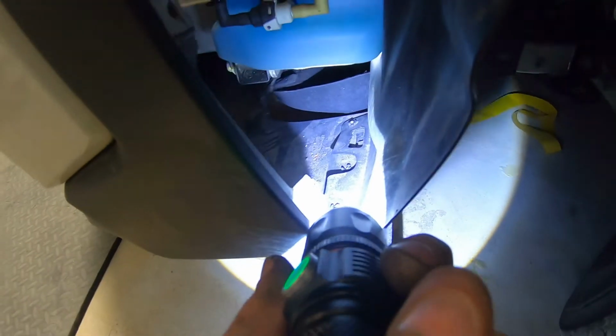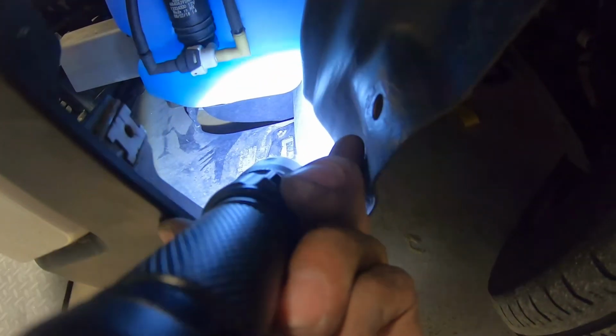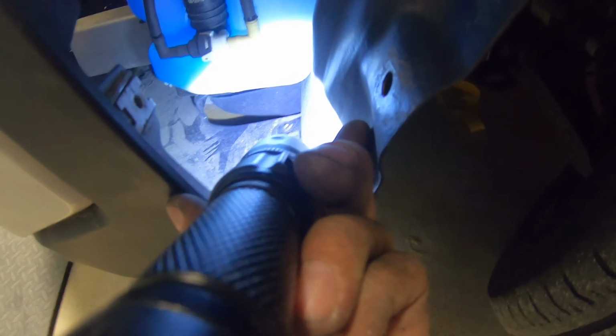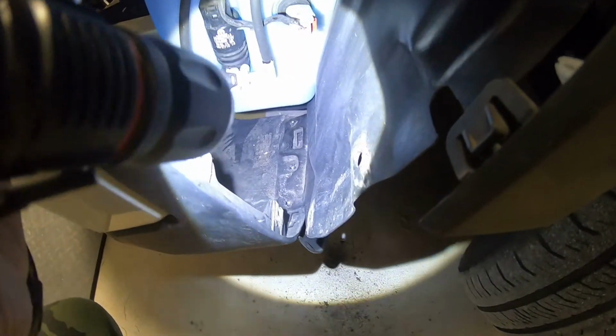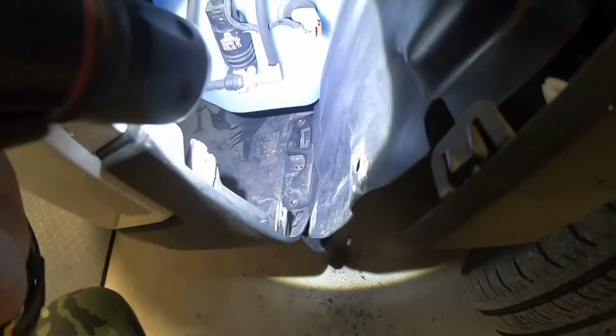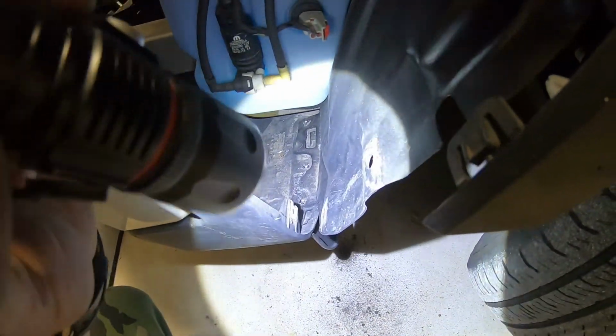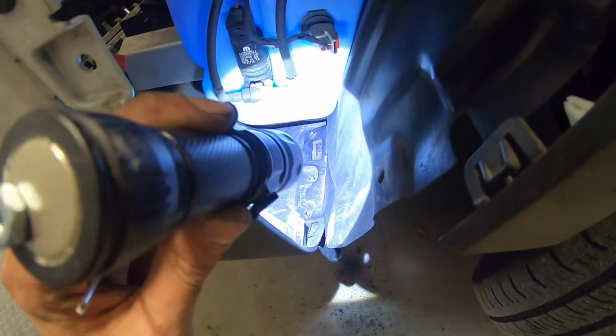And the thing is, I didn't find a way to open them, because earlier I remember I was able to get them out. We were just pressing inside in the middle and they would open. But right now this doesn't look like a legit clip. So okay, I believe they are single-use clips. Basically, to take off the bumper you will need to remove all 3 of them. Using force they will disconnect. You won't be able to reuse them again, but it doesn't mean you can't do this. You can do it and then just use any other clips.